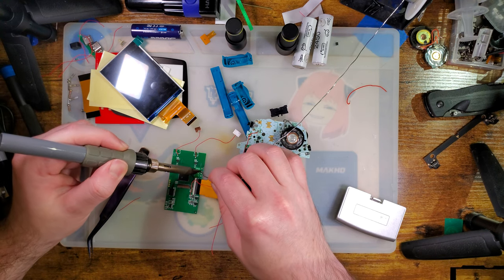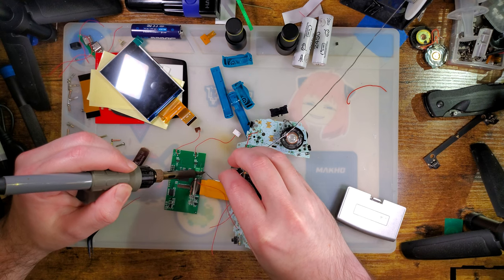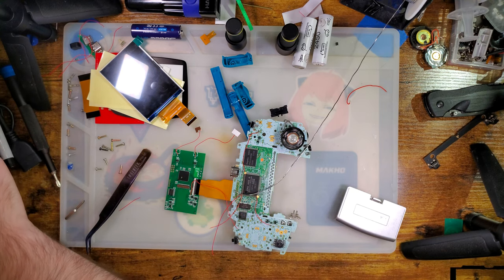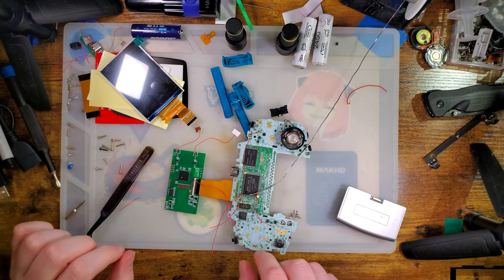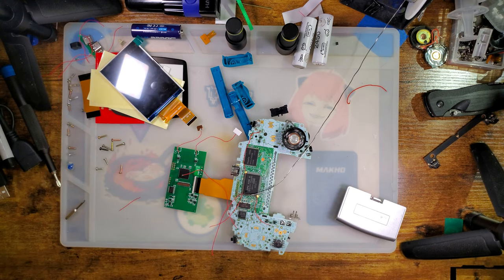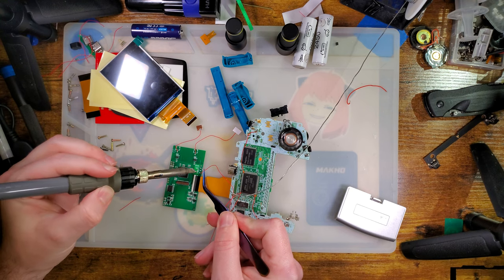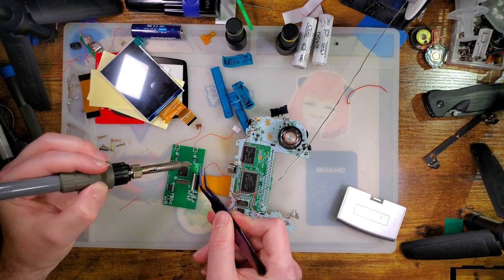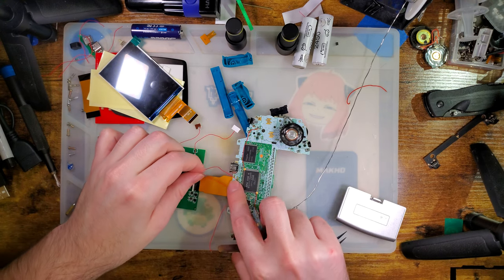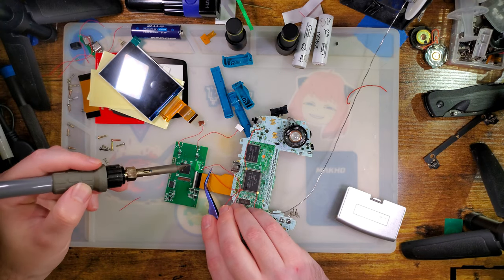And we're going to be soldering right here to select, R and L. Be careful, because I guess they decided to use a sticker instead of just putting the label on the PCB, and I don't remember which is which. So I might get L and R backwards. I'm fairly certain this one is L. So I totally just messed up that label with my soldering iron. Which would make this R. It's a little on the short side, but it'll straighten out when we get this thing bent.